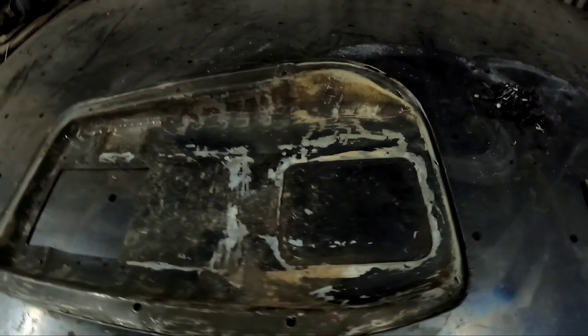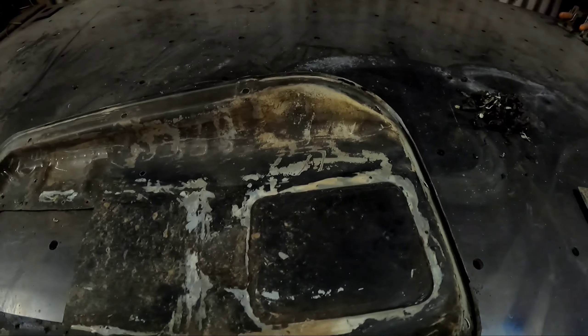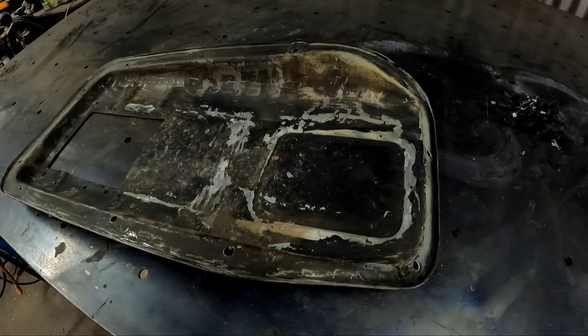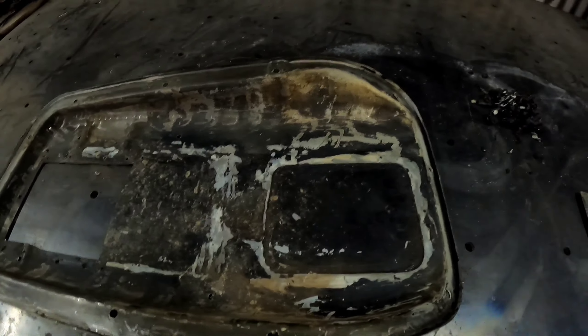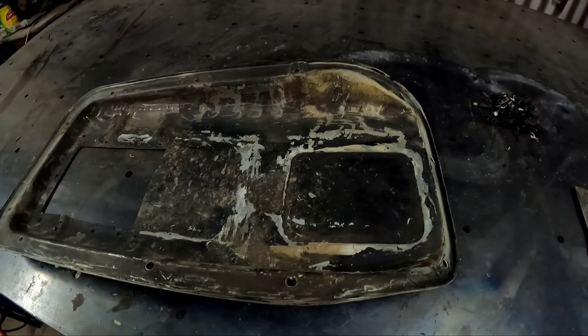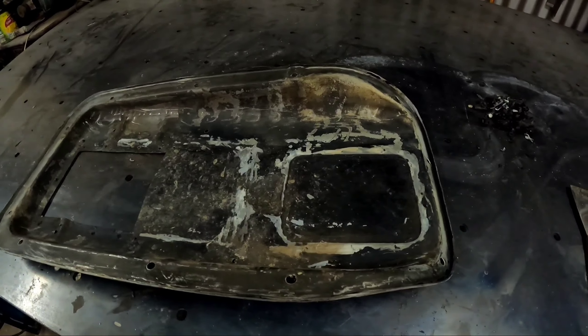A lot of people said run the auto, but the 4-speed's got a really low first gear, which is very handy to get the whole show rolling, especially if you've got a trailer and a car on the back as well. And I don't think the auto's really going to like it in some areas, especially if you've got to start up on a hill. So back to the old 4-speed — a bit rougher to drive, but it's an F truck.